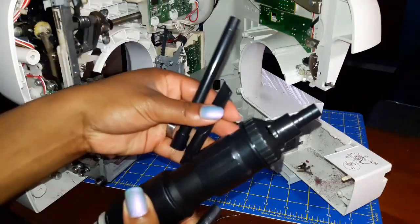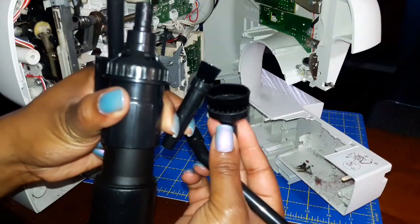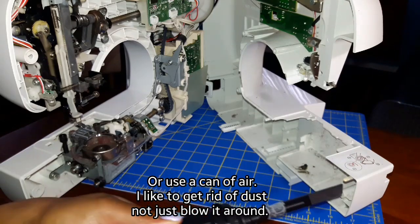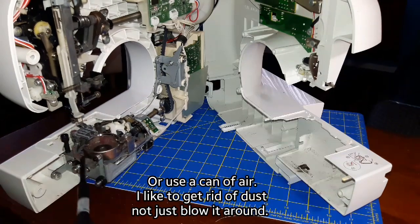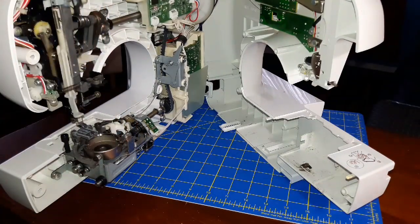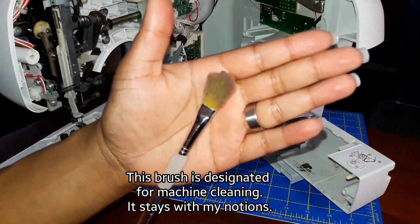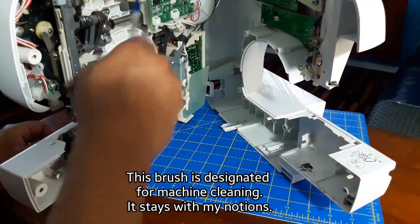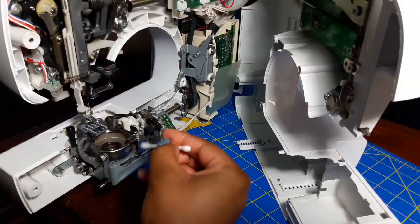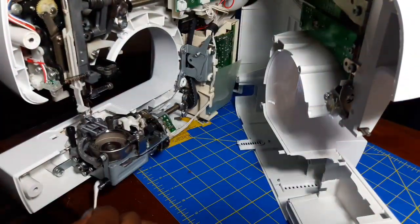And now you see the guts of your sewing machine. You can find a mini vacuum attachment from Harbor Freight Tools. I couldn't get all the pieces to connect to my vacuum hose correctly, so I just taped it on. Use this first to get any large chunks of debris away from your machine, especially out of that bobbin case. Next, use a soft fluffy paint brush to get all the fine debris the vacuum didn't pick up — focus inside that bobbin case, as that's where most of your lint will be.